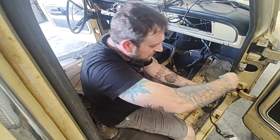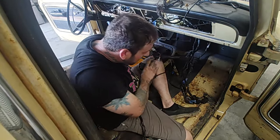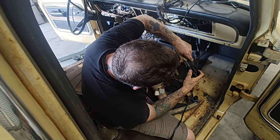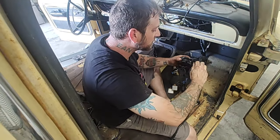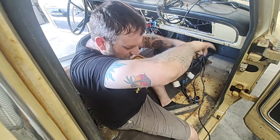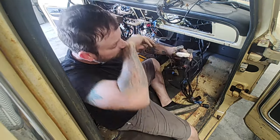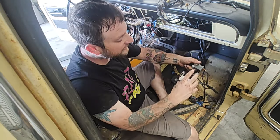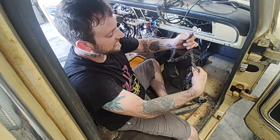Let's take these right here and unwind them down and try to get this as clean as we can. You see this big plug here? That thing plugs right into that — so that's cleaning up a lot right here. We'll tighten that down with a 10 millimeter. We'll pull these grounds out right here and get all these plugged back in. It's pretty simple — they're color coded. Gray to gray, black to black, white to white. They will not plug into another one if you try to put the gray into the white or the black into the gray — they only fit into their own plugs. We'll make sure we keep up with these grounds — those are going to need to be grounded to the firewall.